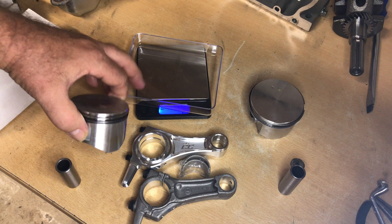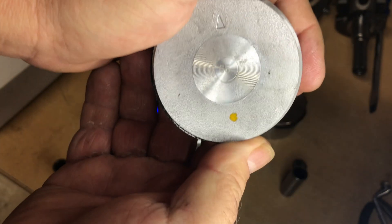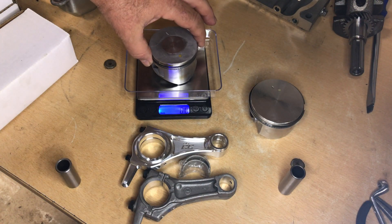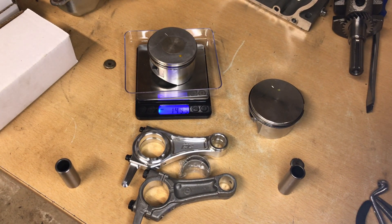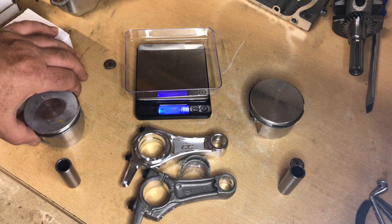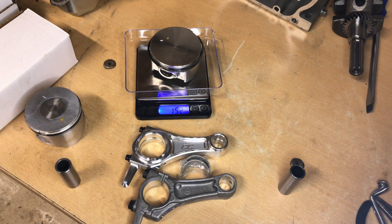I've left the rings on this LCT piston and also left the rings on the Wildcat piston. I'm going to try to weigh as much of this stuff together as I can. You can see it says 65 right on the middle of the piston — so this is the one out of the LCT — and it comes in at 149.3 grams. I'll put all the math and numbers down in the description. The Wildcat piston, with rings and one wrist pin retainer just like the LCT piston, comes in at 152.7.